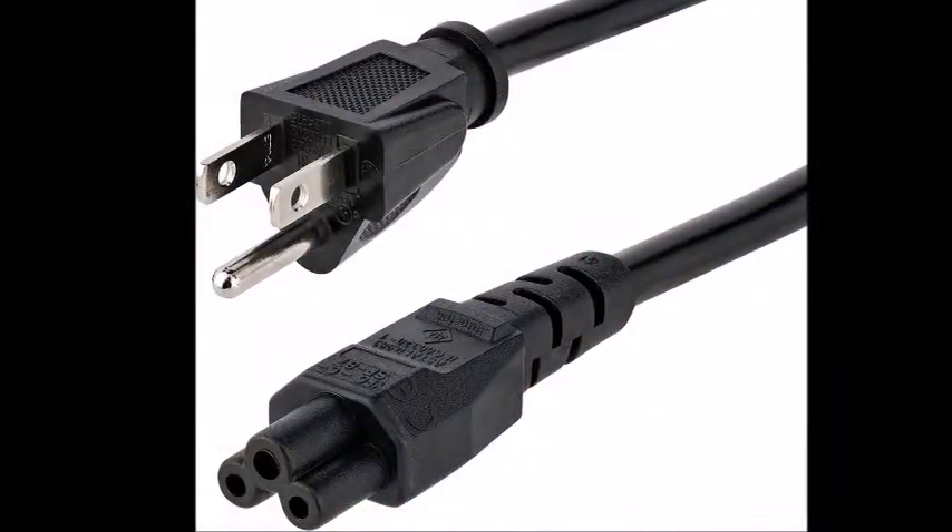This particular Dell has the light on the power cord itself. If it does power on, then it's probably not going to be the power cord. If you realize the power light is off, that's actually good news — because it could be the power brick, or it could also be the AC cord that goes into the power brick. There are usually two kinds for laptops: one is a three-prong power cord.